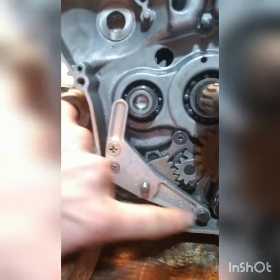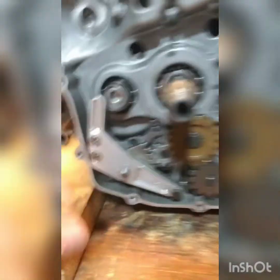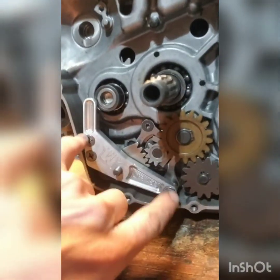What this does is it provides an additional point of rigidity for that shift pin so that if you do land on the shifter, or for any reason you hard-shift really hard, it doesn't break the inside of the case and cause that shift pin to flop off inside the actual case. This is your shift pin relocator — it moves that shaft from inside here to out here and uses this whole piece to reinforce it. So essentially you don't have this small piece of aluminum on the inside of the case reinforcing it; now you have this giant piece that holds all that in place. It allows a pivot point for your shift mechanism and provides more structural rigidity.